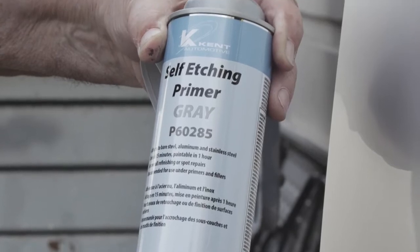There is another product on the market — a self-etching zinc weld-through primer where you can paint right over it. But there are concerns: it's not just about the product on the substrate you're applying it to, whether it's metal or aluminum. You have to worry about all the surrounding area and protect it from the weld-through or penetrating etch primers accessing areas that are going to be cosmetically visible later.